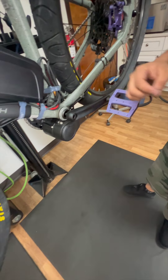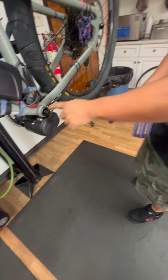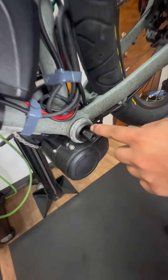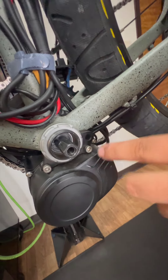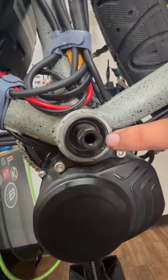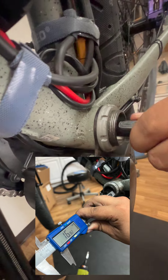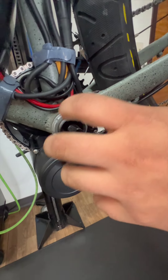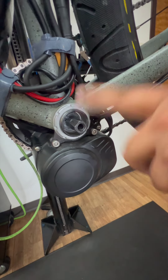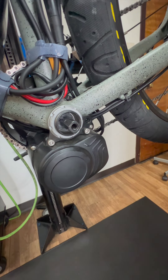Alright, so we're now on the left side of the crank. We've spun the bike around and removed the water gasket that sits here in the shell. If you look inside, you can see how much space is in there — it's exactly 16.9mm of space. That's way too much space, and it can cause your spindle to move freely and possibly break. So there is a hack for fixing this, and we're going to show you guys that next.